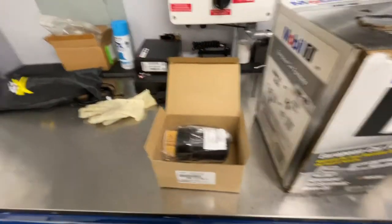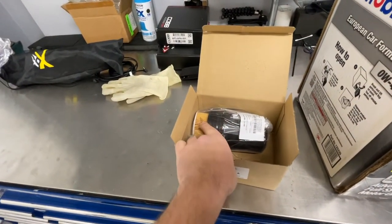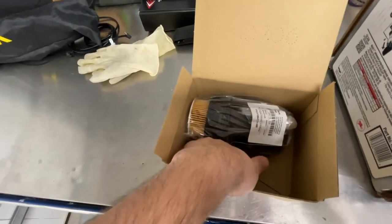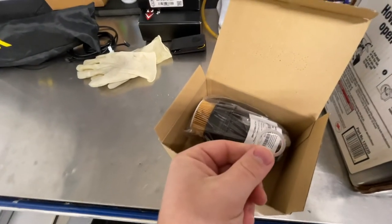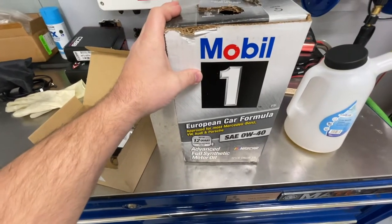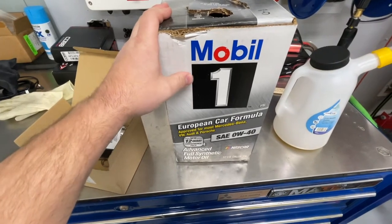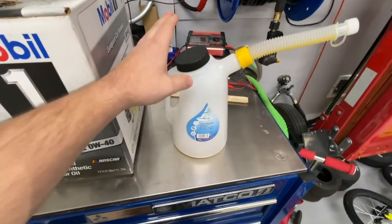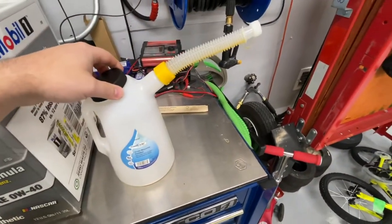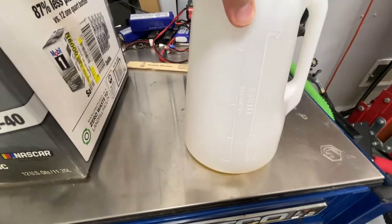Alright guys, here's the stuff I'm using. Here's the oil filter — I buy the whole canister assembled together because you have to buy the O-ring separate from the filter if you buy it from Porsche, and it's only a couple bucks more. I've also got the crush washer for the drain plug. Here's the oil I'm using: Mobil 1 0w40. I've always had good luck with Mobil 1 on all my high-performance cars and it's never let me down. I also picked up this oil fill funnel with a spout that's graduated so you know how much oil you're putting in.